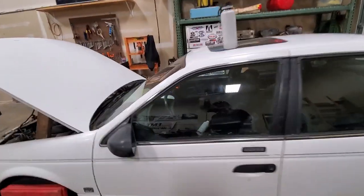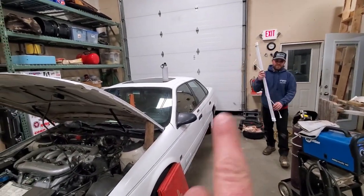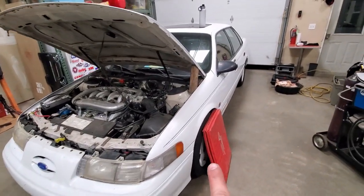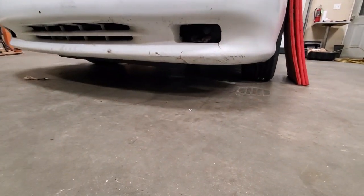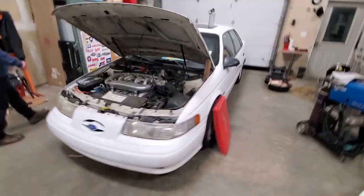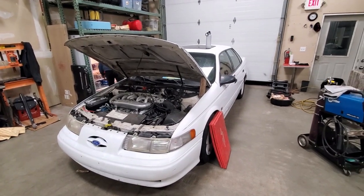the couple things that we got done on this. So I put new calipers in the rear of this unit. Brake pads, rotors. And then we fixed the seal up front on the left side, so it's no longer leaking transmission fluid. But as junk will always be junk, I don't think you're gonna see that underneath there. Yep, there's some more fluid. It looks like it's power steering fluid. I'm guessing it's hopefully not coming from the rack and maybe a line.